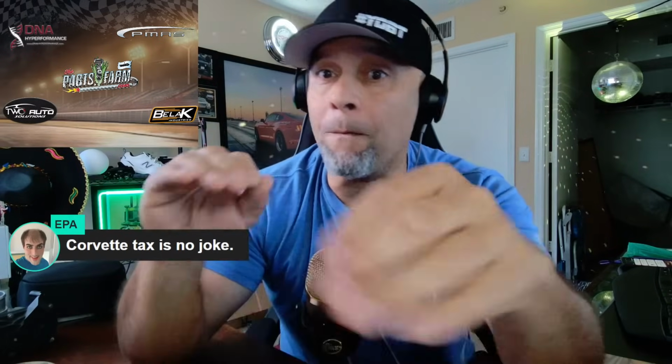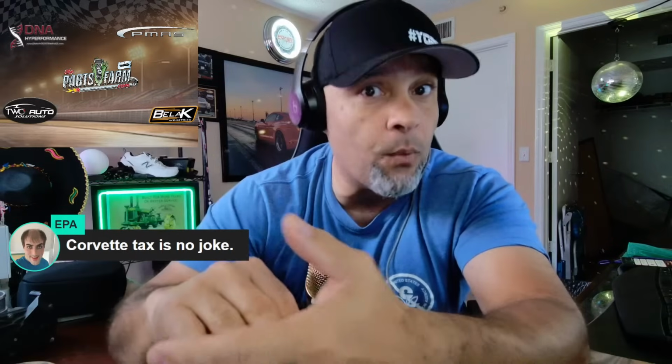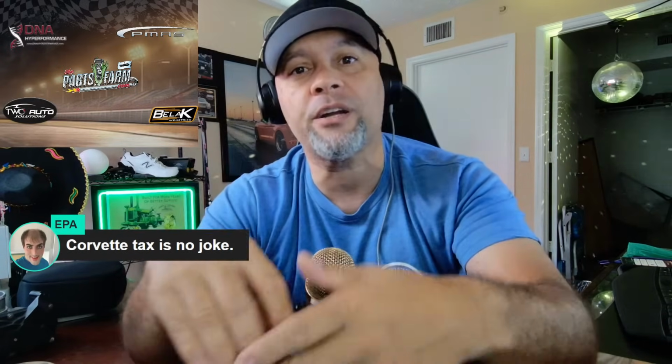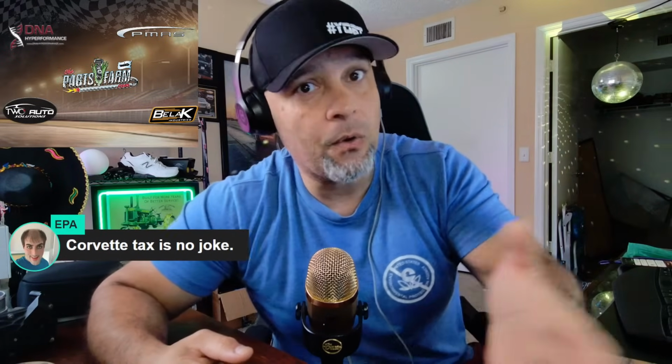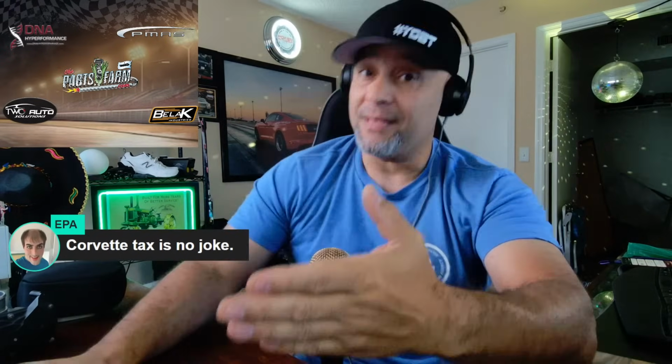And unless you're going to go max effort, and you got to go max effort with a Whipple the way they want you to do it without any manipulation, with a 55-pound injector and E30, which is stressing out the fuel system, you're really going to do that? No, the vast majority are going to do bolt-ons. And since there's no tuning, $1,000 for 10 horse under 5,000 and 2 horse over 5,000. This is the malaise era.